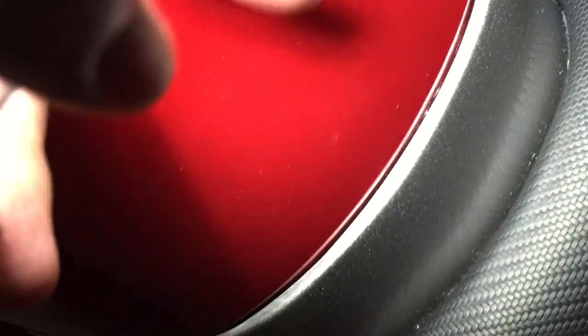So this is how we do it. This mark is just from part of my jacket on the last trip — right in the middle there. It's just tiny little smudges, tiny abrasions. Can't feel them, I can just see them. They're in the clear coat but they're not deep. I can barely feel that one with my fingertip — doesn't catch the nail, no paint missing. It's literally just abrasion in the clear coat.